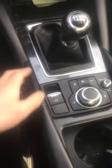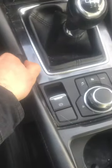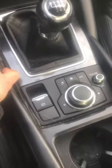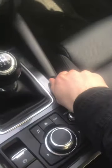First of all, you want to open this up. Get your edge right here — you basically want to pull straight up on it and a little bit outward. It's hard to do with one hand, but pull straight up on one side and then the other. It's just clips that hold it, and the clips are pretty strong. Just finagle the cup holder out — nothing attached to the bottom, pretty simple.